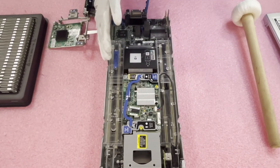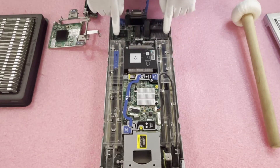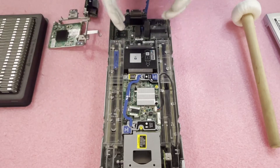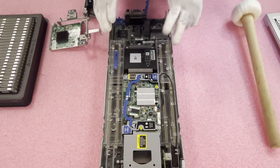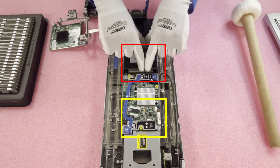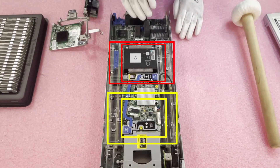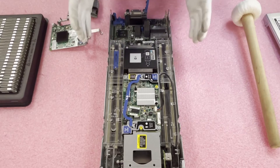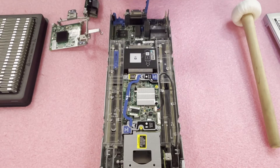Before I remove the air baffles, I want to note that on the air baffles are the actual labels for the channels — which slot is which slot. Sometimes it's on the motherboard itself, and sometimes people put the baffle to the side and can't figure out what slot is what. There are two CPUs: CPU 1 is right here, and CPU 2 is actually under this card. CPU 1 controls the eight DIMM slots on this side; CPU 2 controls the eight DIMM slots on the other side. There are four memory channels per CPU and two DIMM slots per memory channel, which is important so you don't run into the rank rule issue with ECC-registered memory, and you can max it all the way out without running into the quad-rank issue.